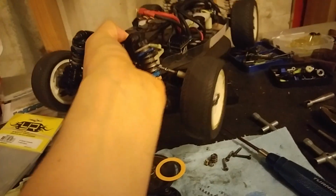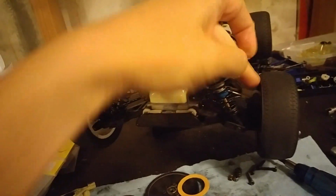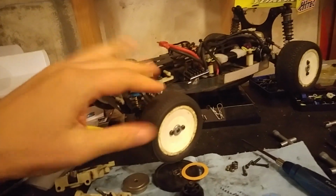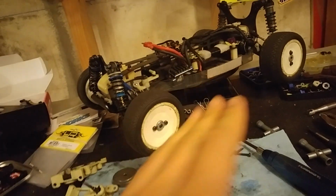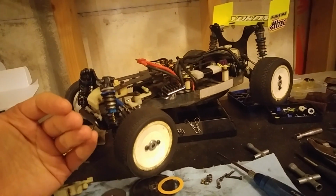Okay, and the whole point of that torque rod was to prevent flex, forward and backward flex on this caster block, and as the car is moving around and going off of bumps or whatever, that caster block can flex forward and backward a little bit. The point of the torque rod stay was to make the caster more fixed, so that you have a constant steering geometry no matter what the car is doing. And for instance, on earlier Works models, like this is the 92 Works, for example, it didn't have a torque rod unit at all. Okay, that was specific to the 93.